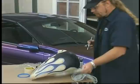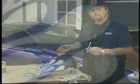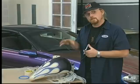Now, as soon as this paint's dry, which is pretty fast with the airbrush, this is nearly, right here is dry. I wouldn't be playing with the tips for at least a minute or so. We're going to give it a little bit of time to dry. We're going to yank off all the tape. We're going to hang it in the booth and clear coat it. And this piece is done. We'll come back a little bit later, and you can see how the ghost effect looks unmasked and cleared. And let's go on to the next step.